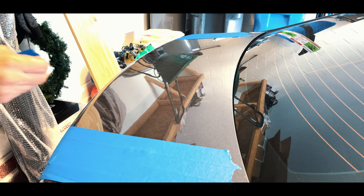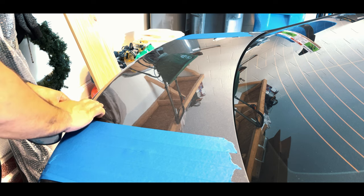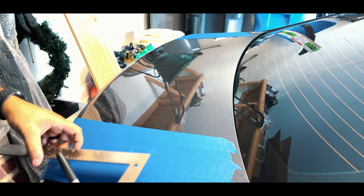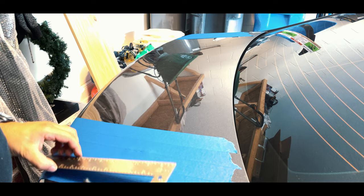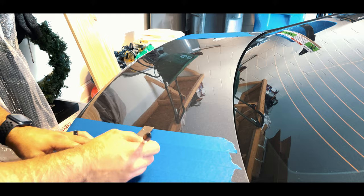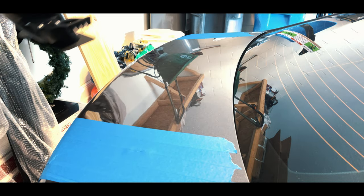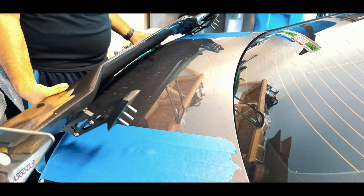We'll be installing our rear spoiler from APR Performance. An easy way to start this process is to add painter's tape to the trunk so you don't leave any marks on the paint. This is the most tedious part of the whole install — make sure you're precise on both sides of the trunk. Use a ruler and preferably a pencil to leave your marks and get exact measurements on both sides. I recommend having someone else hold the rear spoiler while you make your adjustments and marks.